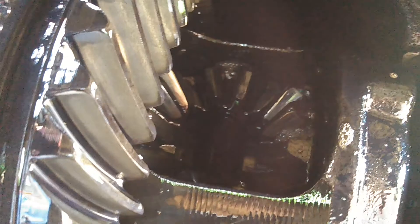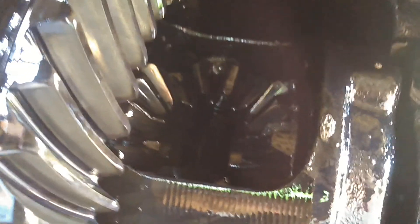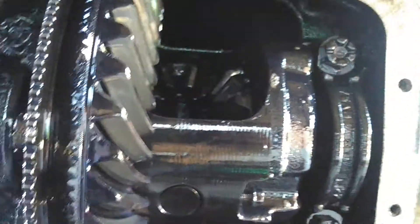Then you'll go back to your axle on the outside where the tire mounts. Push inward — whenever you push inward, you'll see the shafts pop out right there, and you'll see the C-clips. You can do one at a time. Get the C-clips out, and once you get the C-clips out, you'll be able to pull the axle right out.